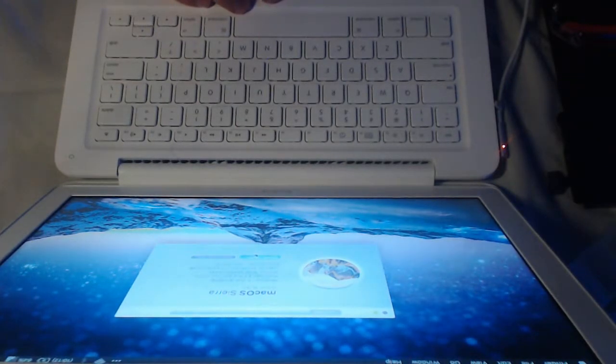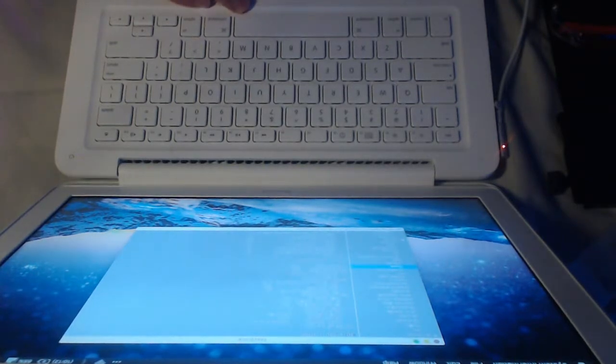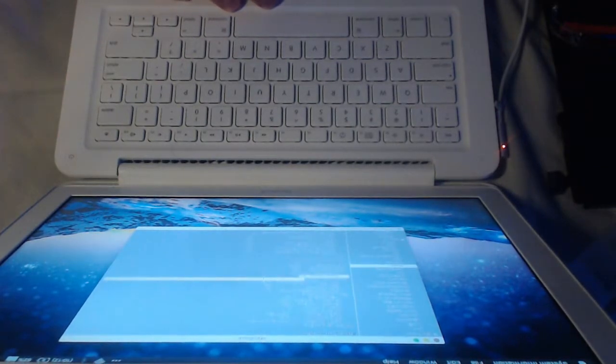So let's see. So system reports, and over to power. Let's see, battery installed. Yep. Cycle count only 217, so this is not a brand new battery, but it's a heck of a lot better than the 890 something that we had before. So that's awesome. It's not charged at all right now, but saying a full charge capacity is looking like it'll be 4,710. Which doesn't seem right, primarily because this particular battery should go up to close to 6,000 when it's fully charged. So that could be something with the SMC, but yeah, it's looking pretty good.